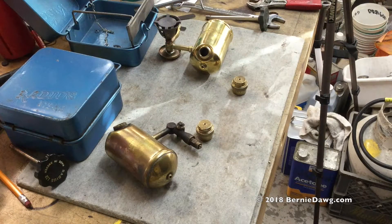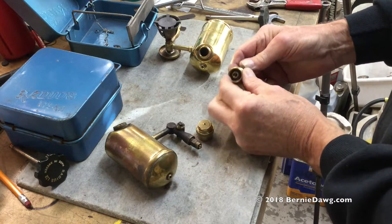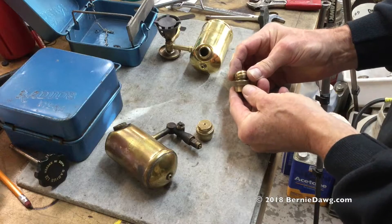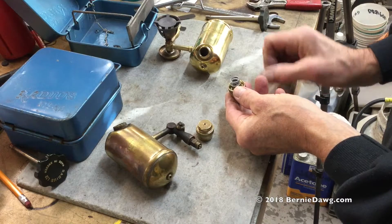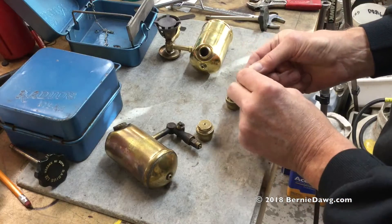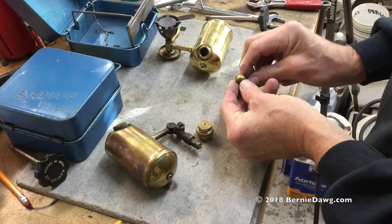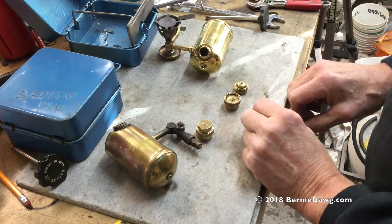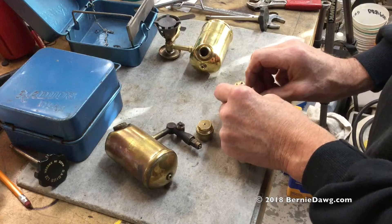I'm lucky enough to have two Radius 46 stoves, both of which have the safety release valve cap. The one I'm opening up now is in the kind of condition you generally find them. The outer cap unscrews to reveal a very stout spring. The spring rides in a brass piston arrangement. Beneath the piston are two seals — one is a thin brass sheet and the other is a thin piece of rubber or rubber-like material.